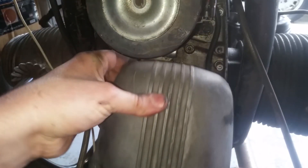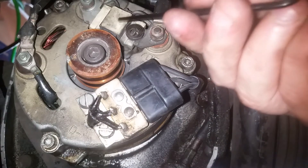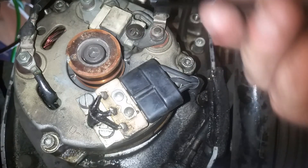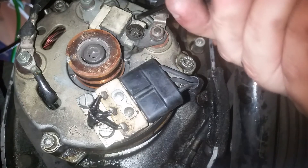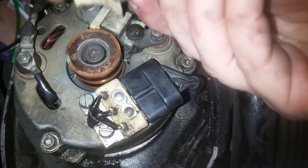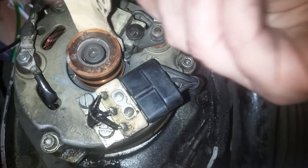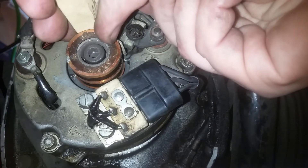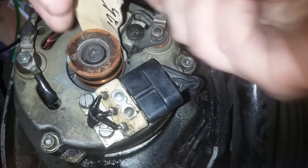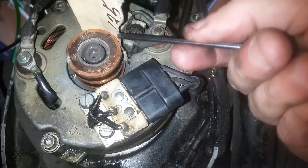Disconnect the battery. Remove the front cover. This is what's known as the business card trick. You isolate the two brushes from the rotor by sliding a business card between them. You lift up on the brush wire — which I don't like to do, but this is how you do it — and then you slide the card between. There's one in the back too. So that's pretty well in there. Now the brushes are not contacting the rotor. The rotor is isolated.